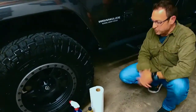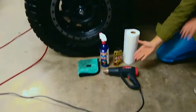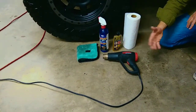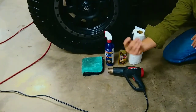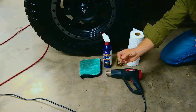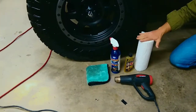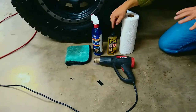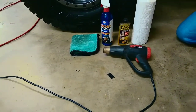To do that, we've got a few tools. Two tools and some other stuff. We're going to start off with a heat gun — this is essentially a glorified hair dryer. It's going to warm things up so that we can peel it off easily. To help it come off, this is a plastic razor blade. It's not a real razor blade; it's not sharp at all, but it helps us get the edge up in place of your fingernails. Then we've got some paper towel, some Goo Gone to help get the rest of the residual mess out of the way, a little bit of detail spray, and a nice towel to wipe everything down with.